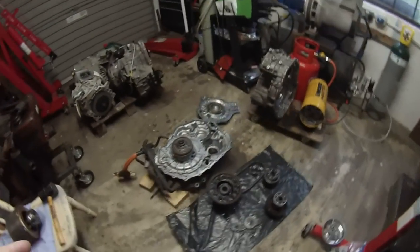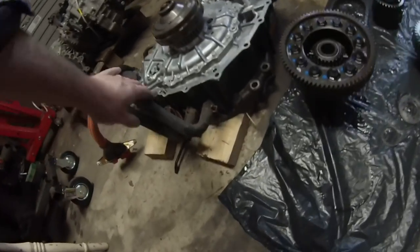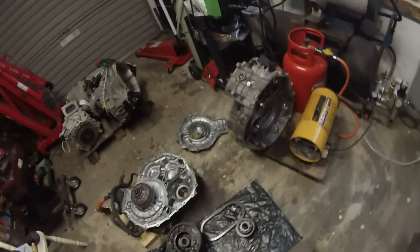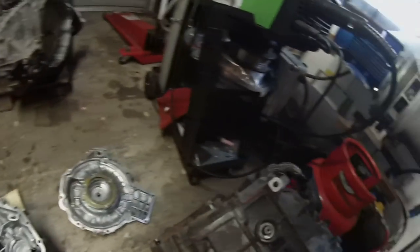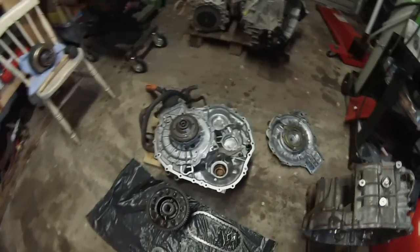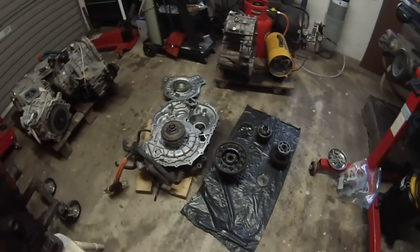Second comment: Damien, that's not going to work — those motors can't run full power all the time. Very few internal combustion engines fitted to modern automobiles can either. But on the Gen 2 transaxle, Toyota have made this easy for us because they have split the cooling ports between the two case halves. Here we have the cooling hoses for MG1, and over here there are two pipes — we have the cooling hoses for MG2. So we can split the cooling loops and get extra cooling going on there, and we have temperature sensors built into this thing.